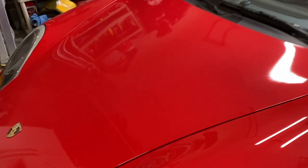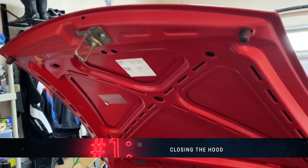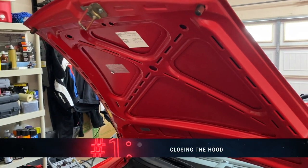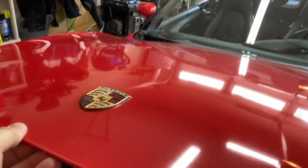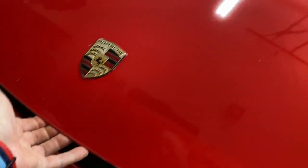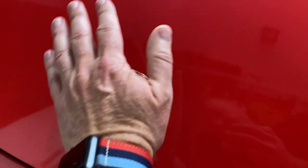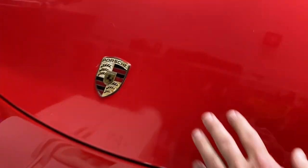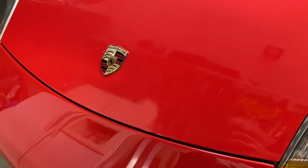This is my 1998 Porsche Boxster 986 and as you're probably aware, to lift the hood there's a nice little tag under there, but trick number one is closing it. Something people don't talk about very often, but my mechanic gave me a tip right when I bought this car. Instead of trying to slam it, just set it down and put your palm right on the crest and press down — it will click in. If you press other places it can dent your hood, so super easy way to close it without any damage.